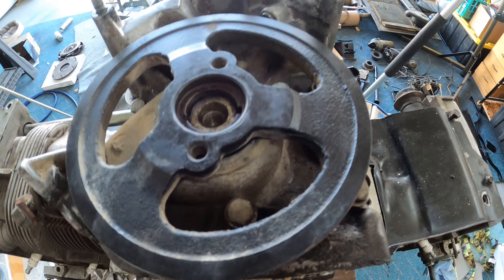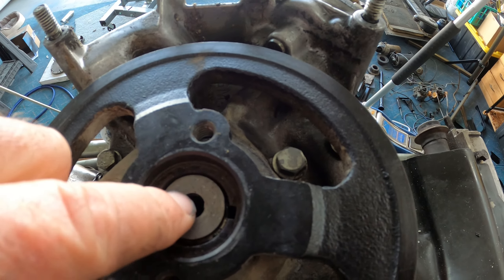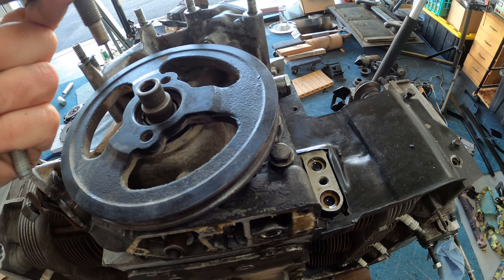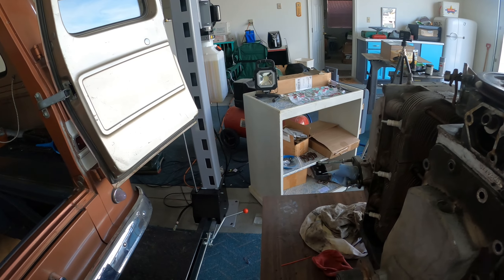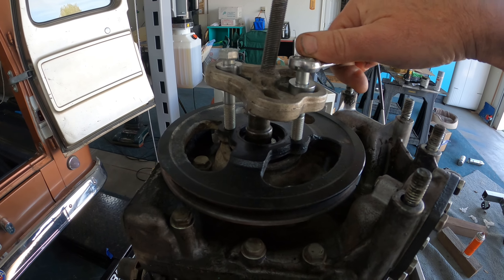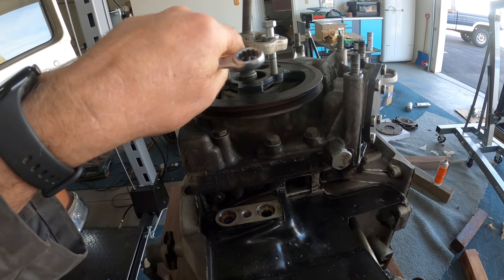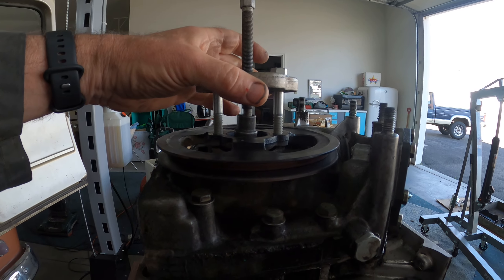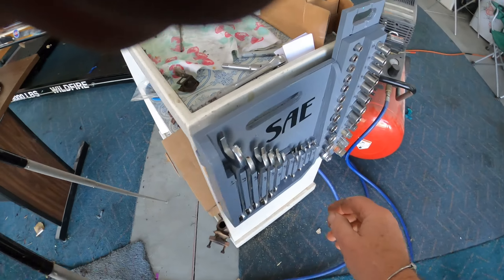You can see this is keyed, and this pulley has threaded holes on it. I found this washer that will bear down on the crankshaft but not on the pulley. This is the puller — these two screws go down here. You want to get these screwed down about the same amount so that the puller and the pulley are parallel. That looks pretty good.